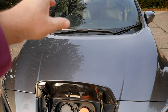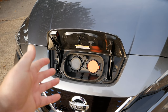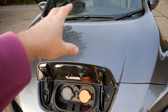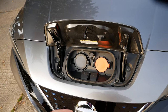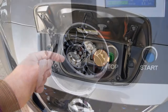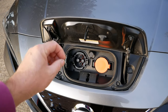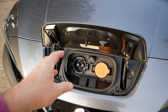The sat nav can identify public charging points, but I tend to use the Zap Map app on my phone — you can also use PlugShare. Phone apps are always more up to date and thorough than the in-car information. The Nissan LEAF uses a CHAdeMO connector for rapid DC charging, so filter the Zap Map app to show CHAdeMO charging points and it will show your nearest ones with prices, network information, and now also does route planning for longer trips with charging stops.